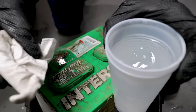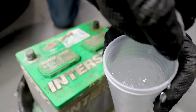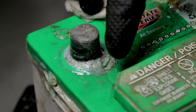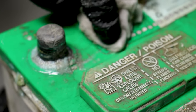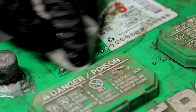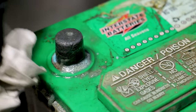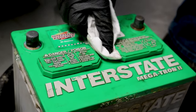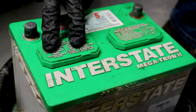With our little concoction, a nice rag, and a gloved hand, go ahead and dip it right in there. Get it nice and wet, wring it out a tiny bit, and work your way around. Try to avoid the caps as much as possible — if the fluid touches them a little bit, that's okay, just don't make a big flood of it sitting there for a long time. Wipe this down, get it as clean as possible, then take another rag and dry it off as soon as possible. The whole point of using as little as possible of the concoction is to make sure none of it gets inside where the cells are.